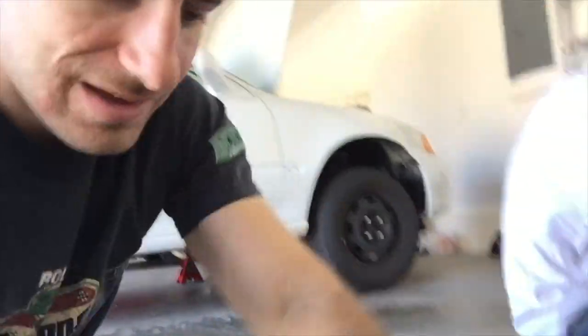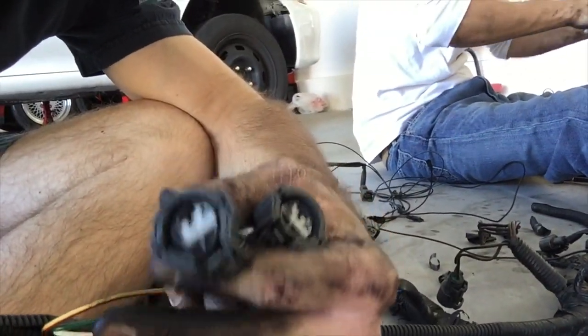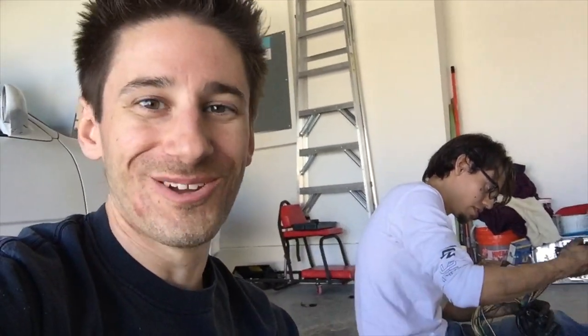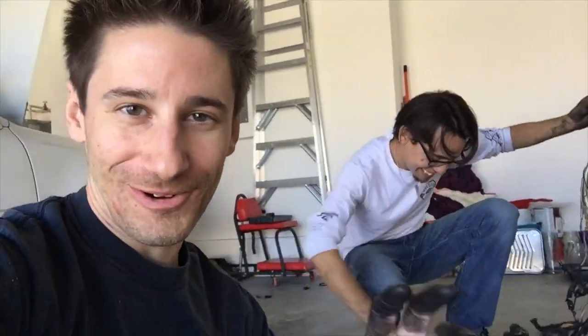On the harness I already had, these are the throttle position and MAP sensor plugs, and they are the same. Essentially what we've come to is that even though Juan did a super nice gesture getting this harness, it still isn't going to work for us. We need to go back out to the junkyard and find a harness that has the throttle position sensor, MAP sensor, and the four-wire O2 — the whole reason we started this. Everything else should just plug up fine because this other harness plugged up fine until we went to connect the MAP sensor.